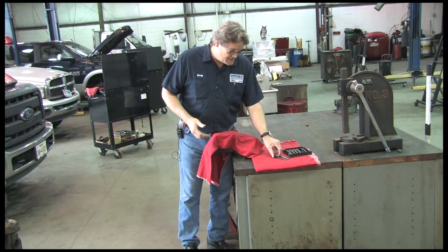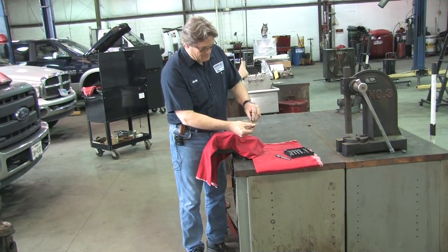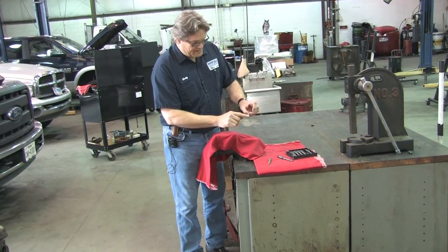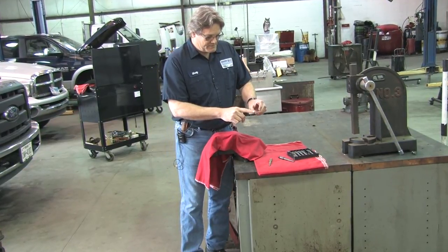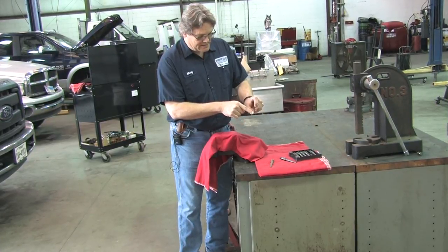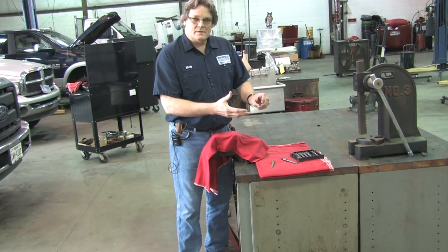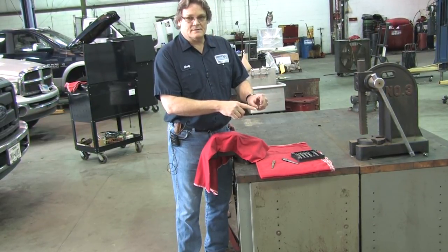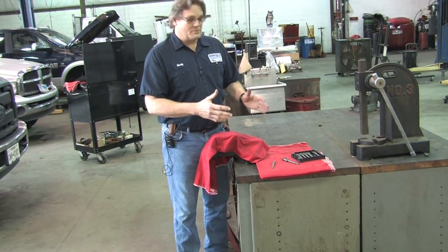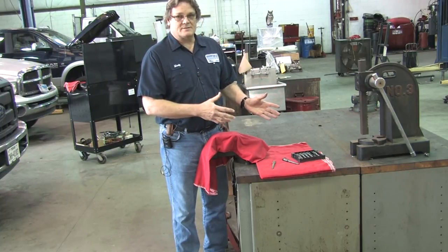But also, you can see right here, this is a cutaway, and there's that edge filter we're talking about. And even this one has debris in it. And again, we're back to fuel contamination, age. These things wear out. The high-pressure fuel actually cut this edge filter. If you have a high pressure pump failure, it's going to put metal in here. So again, I cannot stress how important it is when you change a set of injectors or one injector, you need to change these connectors.